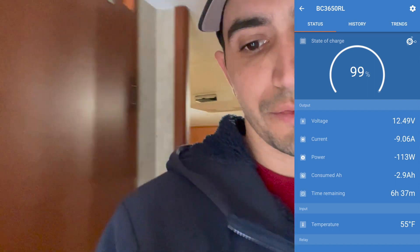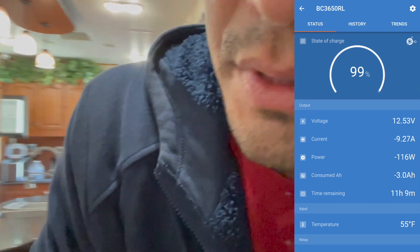Let's see what else we can run off just the batteries. Let's turn some lights on and try the TV and see what kind of amps it draws. Right now the power is running strictly off the batteries through the Multi-Plus through my inverter. Now we're looking at the battery monitor so we can see how much juice we're really using. You can now look at the battery monitor and say, okay, my TV uses three amps. Good information to have. So we'll turn the TV off.